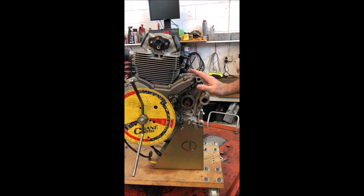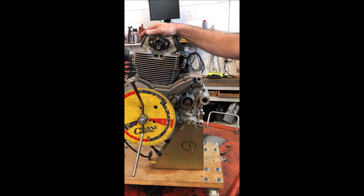This engine is 32,000 kilometres old, so it should have had two valve clearance adjustments by now and one set of belts. I was going to check the belts, then check the cam timing, tension the belts to spec, and check the cam timing again. As it turns out, the belts are at 100 hertz and one of them is at about 110 hertz, which is a bit too tight on these engines in my experience.